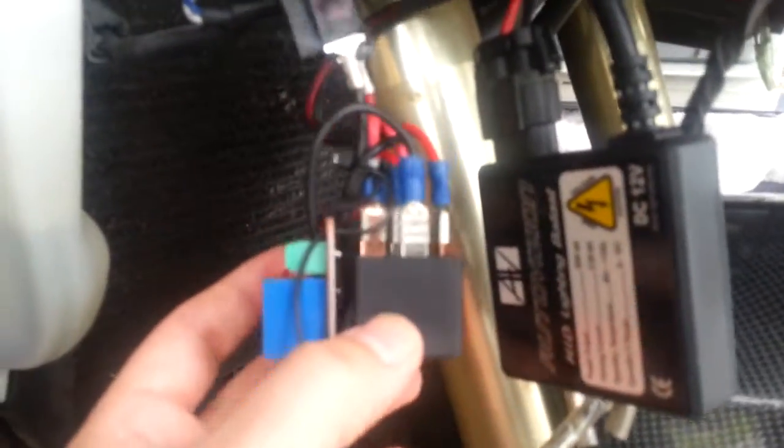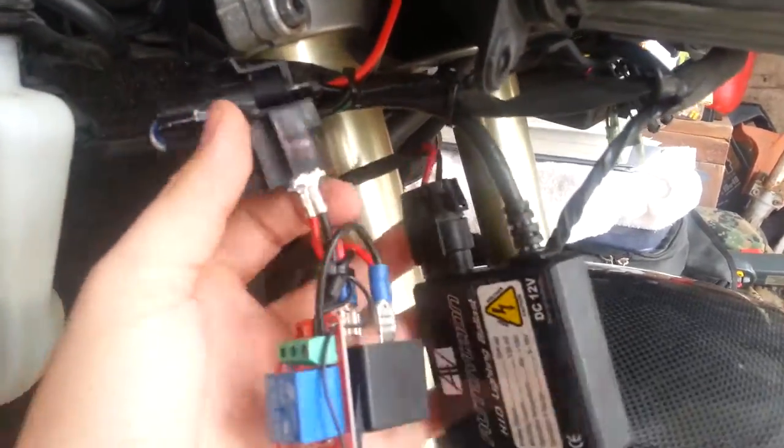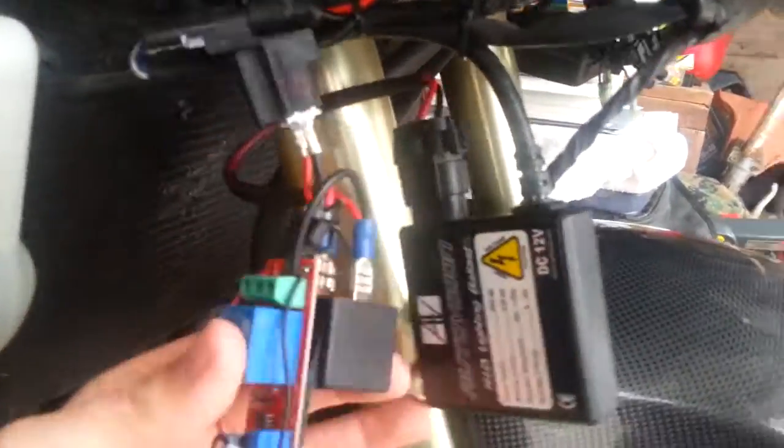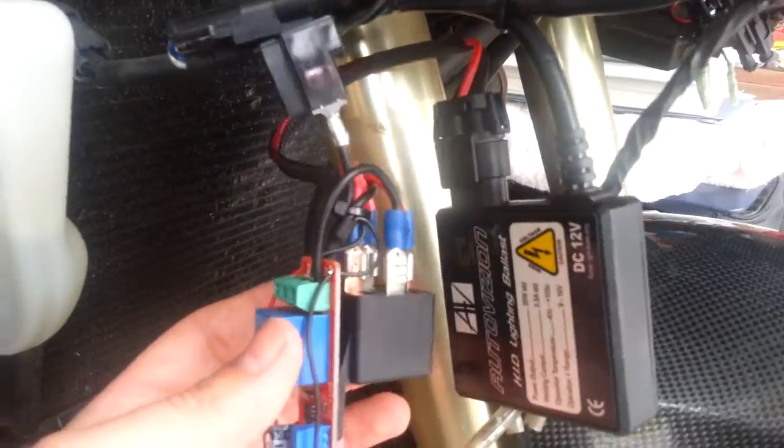This delay switch was about $2 on eBay. Now it's not powerful enough to power the lights themselves, so I also had to get an automotive relay, 12-volt DC. The new HID lights came with a nice little cable between the original adapter to the light and the ballast, and I hardwired it right into the ballast. It's pretty complicated — ask some questions and I can tell you how I did it.